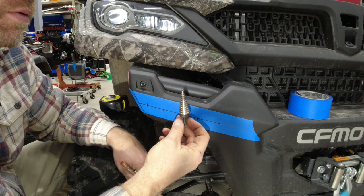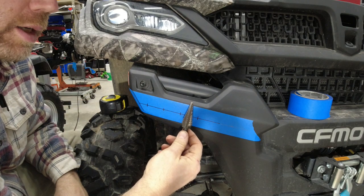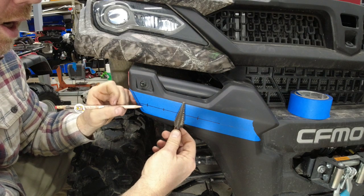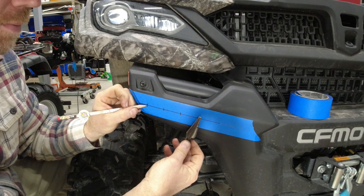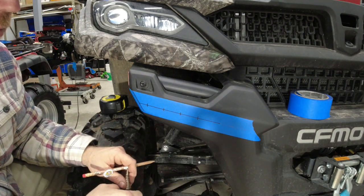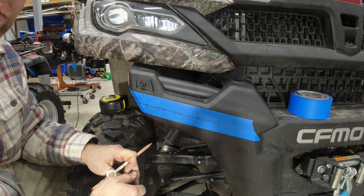The other thing I always recommend, and I tell apprentices this on the job all the time, when you're laying out a bunch of holes in an electrical panel or anything where you need to keep them in a straight line to keep them looking nice, don't rely on the tip of your unibit to stay centered along your center marking. I'm going to actually make pilot holes exactly in the center, and then probably step them up a size or two before I do my final drilling with the unibit. That way you don't have to worry about it walking around and then your light's doing something down there. So that's what I'm going to do. I'm going to go ahead and get these blasted in there and then show you how to do the wiring on them.